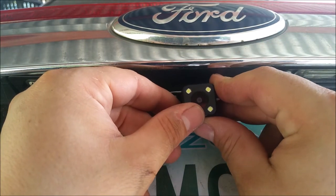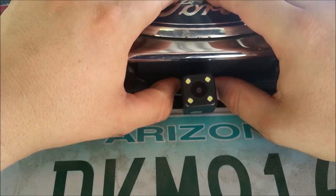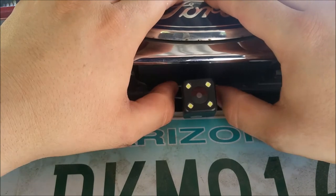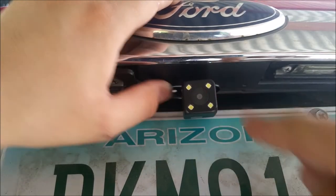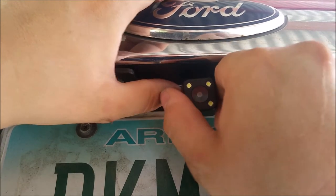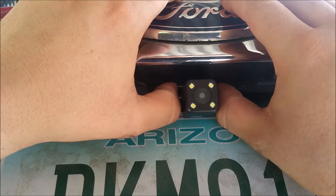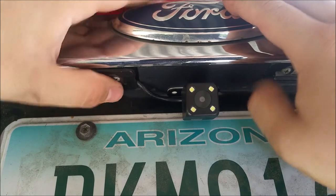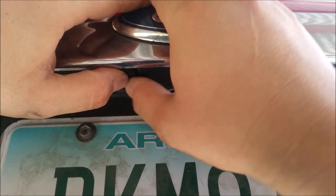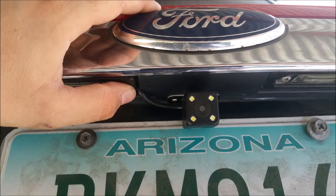I didn't show much of the panel removal and reinstallation because it varies from car to car — you can find YouTube videos for anything. I did show you how to take the panel clips out because that's pretty uniform across all brands. I'm going to mount the camera about right there, pull off the sticky pad, bring it all the way back, and attach it in. It does have two places to put screw holes, and I'm going to go ahead and mount those just for good measure. Now we're all back together and ready to check it out inside.